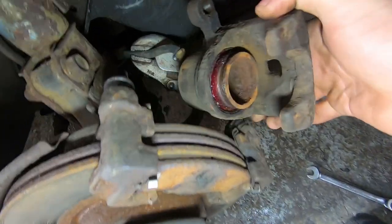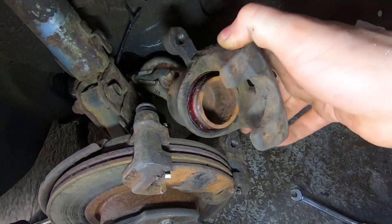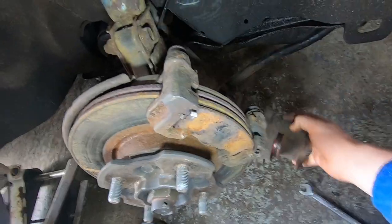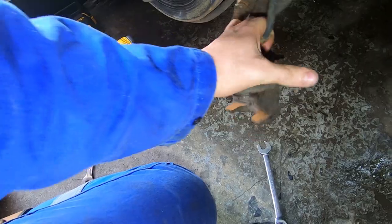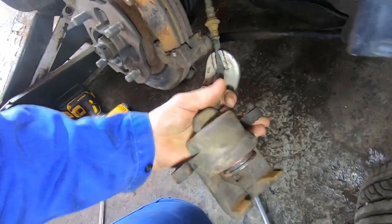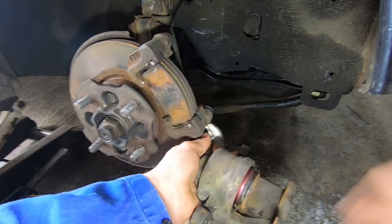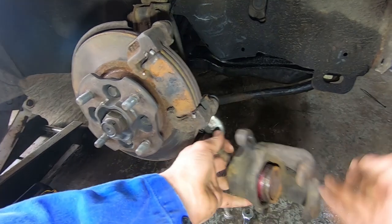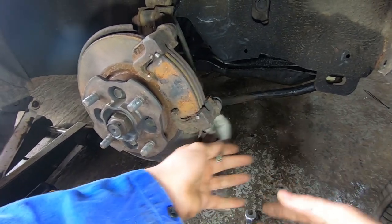As you can see, it's packed full of grease. That's because my seal basically died and these seized up — that's why I'm replacing them. I just cleaned up the piston a little bit to make it last longer until I got the parts. Now I'll just spin this off and the caliper should fall off — just like that, caliper is off.